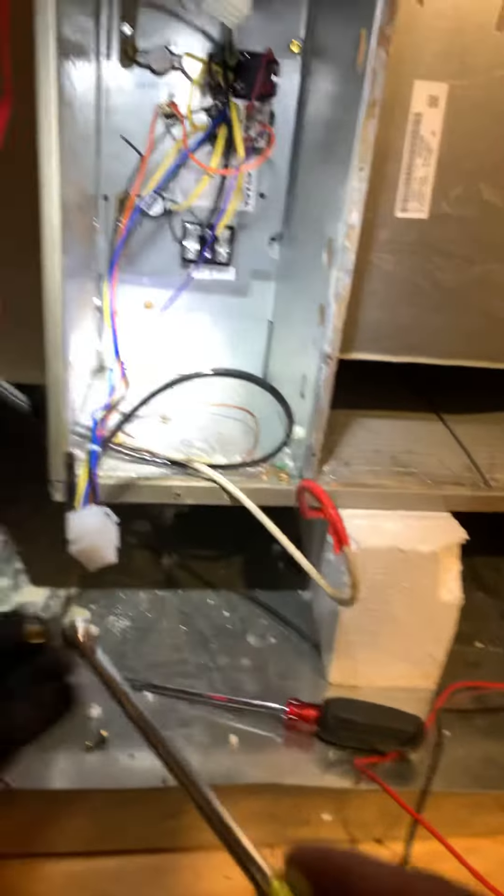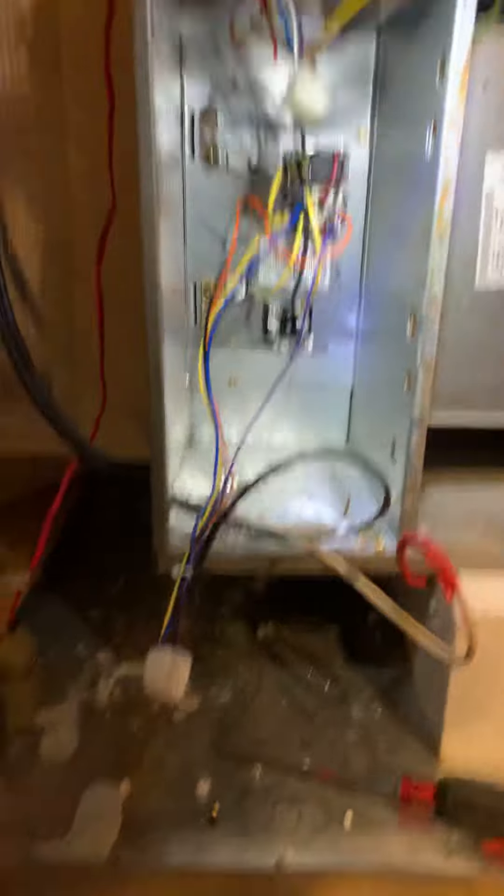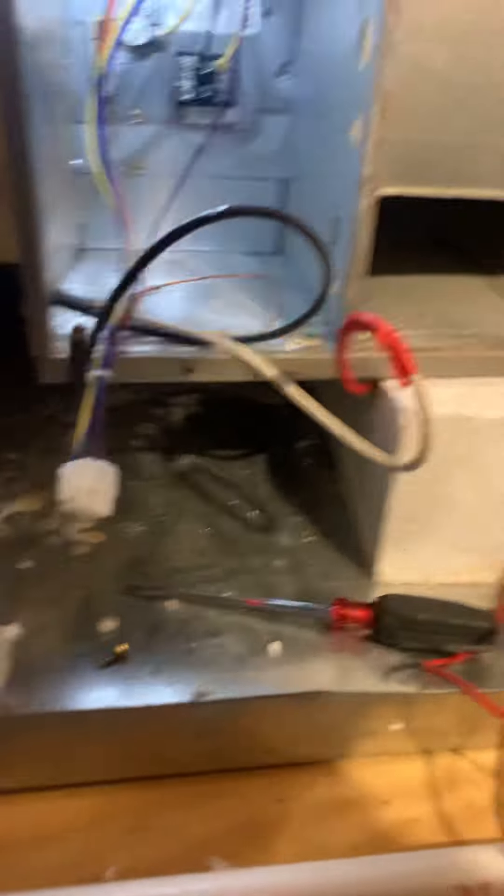Now, these people were getting heat from the heat pump, not from the heat strips. I think it's the wrong screw, so I've got to put this in there. Beautiful. Let's go ahead and take this one out because this one actually goes to the cover — the air handler cover. Put that back, put the right screw — they're actually a little bit smaller. So this is a 10kw. And that's pretty much it, really. Then you're going to connect the high voltage there — let's go ahead and do that first.